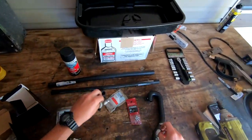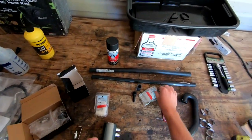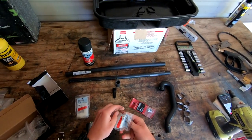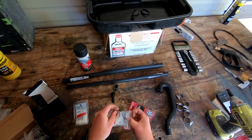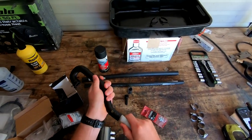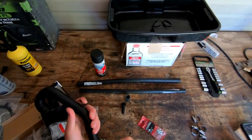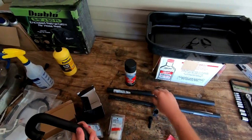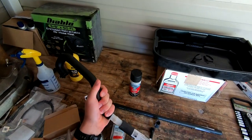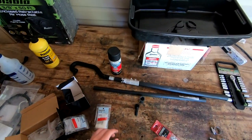I got rid of mine a while ago — trying to remove it I broke it, so I said screw it. Every once in a while you'll see a little drip of oil that sprays all over your front cover. This is the stock piece off the truck. I also have miscellaneous hose clamps and two pairs of pipe. I went ahead and got a splicer — it's a three-quarter inch inner diameter. The plan is to use this, shove it in here, and it's just air and a little bit of oil so it won't hurt anything.